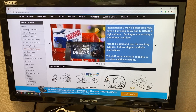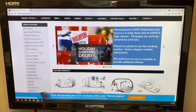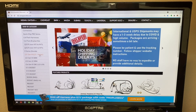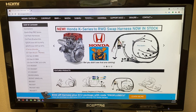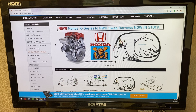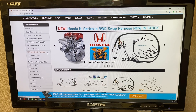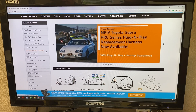Hey guys, it's Earl and Brian here. Today we're going to talk about some of the differences with LS engines and drive-by-wire setups. Right now we're not offering a Gen 3, which would be a standard LS1 drive-by-wire. That one's only available cable, which means you have to use the 411 PCM or a P59 PCM for that setup.